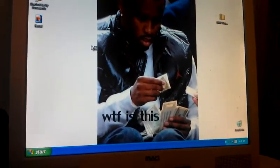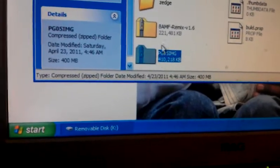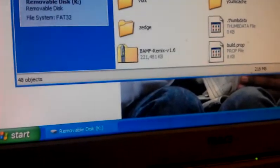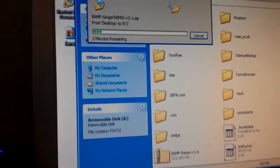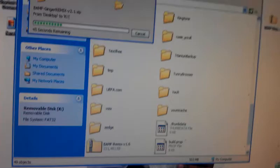My computer. Here's the phone. He has BAMF Remix version 1.6 on there right now. I'm going to delete that, we don't need it. Now I'm going to transfer the new ROM straight in here — it'll take a minute, it's about 250 megabytes. When you download the ROM, make sure it completely downloads. You get the whole file. When you download it, it should tell you the size and you can check it by right-clicking. Make sure it's the right size so everything is downloaded correctly, because if it's not all there it's not going to work and you might mess up your phone.